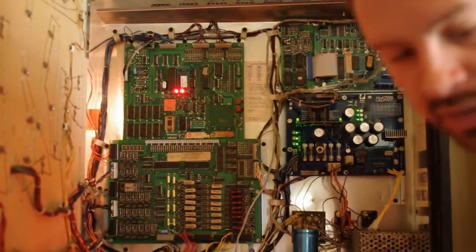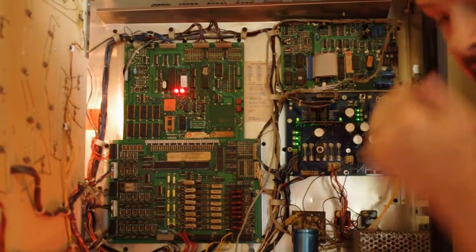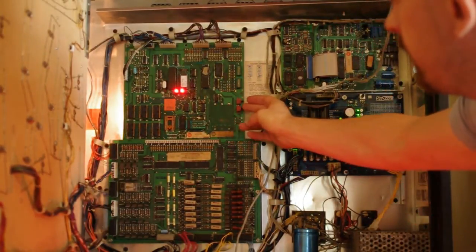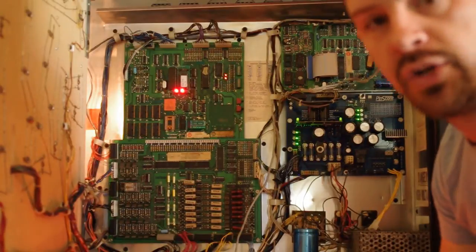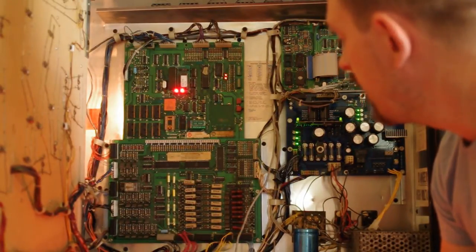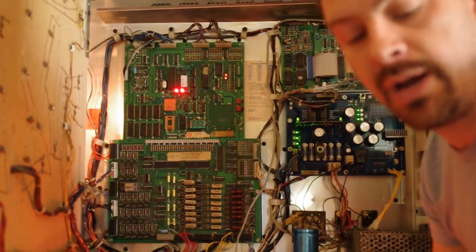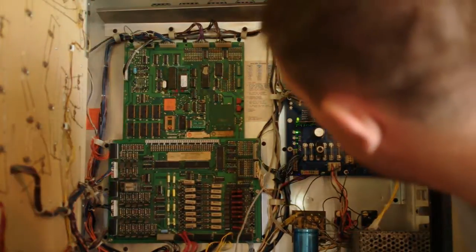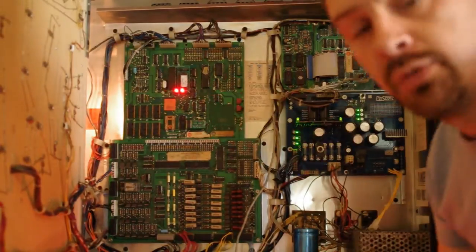Your lower diagnostic button will give you a quick check of your CPU board. Press it and you should see two blinks, and then it'll go into basically nothing — that's a quick RAM and ROM check of your machine. What you want is those two blinks and then the lights to shut off. If any lights stay on, you have a problem. Note that if you have your coin door closed, the memory protect circuit will give you an automatic failure — the lights lock on because when your coin door is closed it protects your settings in RAM. So you want to make sure to do this with your coin door open.